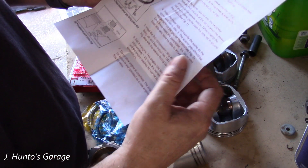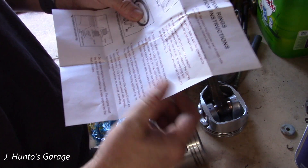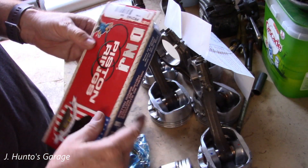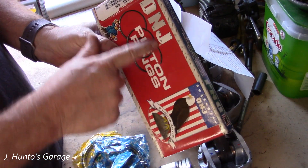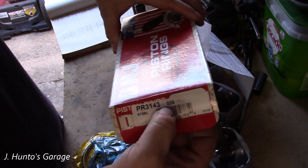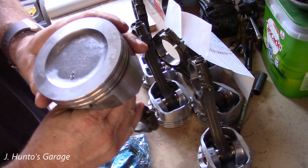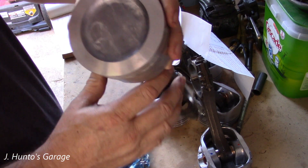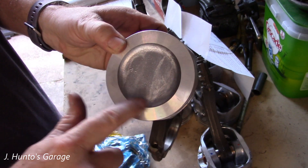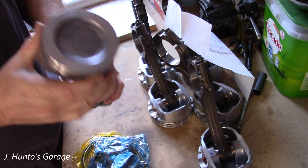I like to space the gaps at 180 degrees. This is where I bought the piston rings online — the whole engine kit — from DNJ. These are steel rings and they are 30-over, which means the cylinder has been bored 30 thousandths over standard, so the pistons have to be 30 thousandths over. There's also a direction marking for which way the piston faces the front of the engine, and these have an extra dish area because they are pistons for a supercharged engine.